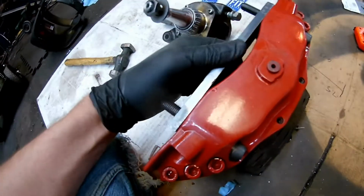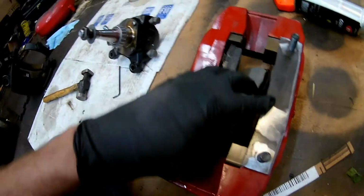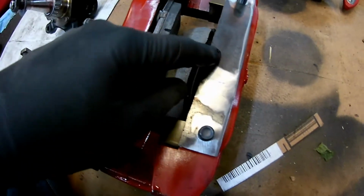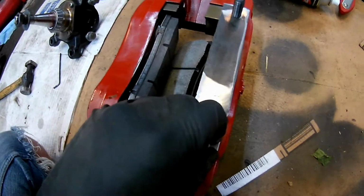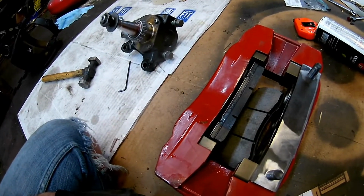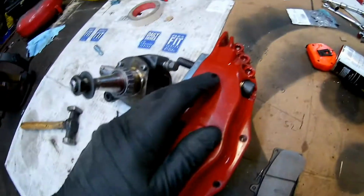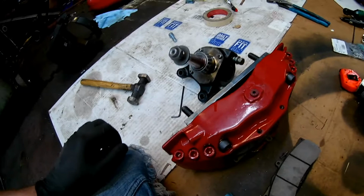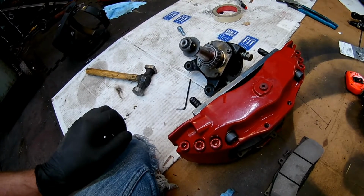these plates, I have a bandsaw, which is nice. You could use a cutoff wheel. It doesn't have to be that precise. These holes have to be exact. And I tapped them. So it's an M12 by 1.75 thread. I have a drill press from Harbor Freight, just making sure that they're exactly right, and then when you run the tap through, it is exactly straight, because you're talking about a pretty long bolt that goes through there, and if it's off any, you'll have to take other measures. Don't ask me how I know. So that's basically a little start to getting them on there.